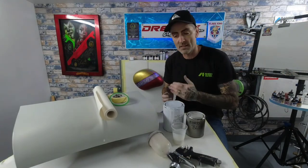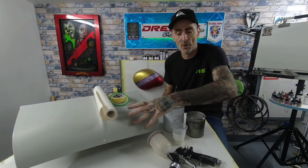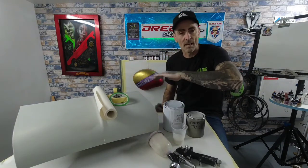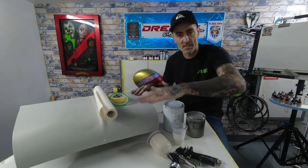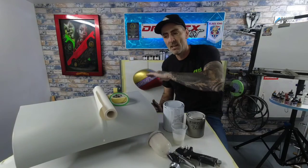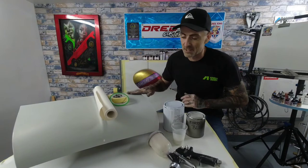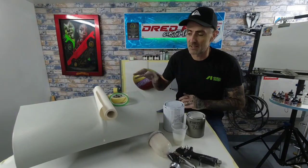Give you a little talk through on that last time lapse. The first stage on that, I went in with the guide coat and we guide coated the bonnet first, and then I went in with a 320 disc with the soft sponge on the back and flatted the guide coat back, so you lose the black and you take your first layer of primer off, which sends it sort of flat. And then I moved on to doing the guide coat again, and then went in with a 500 disc, and you're basically knocking back the guide coat again and you're knocking them 320 scratches back, and you're getting a nice smooth finish with a 500. So that's finished that piece, that's good for base coat.